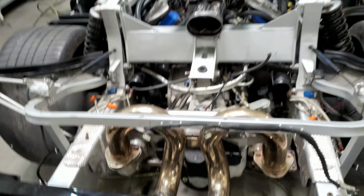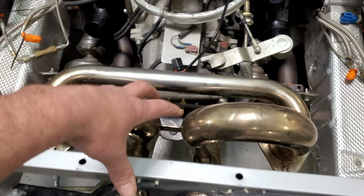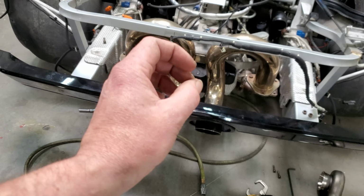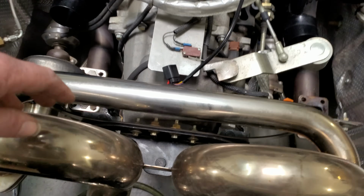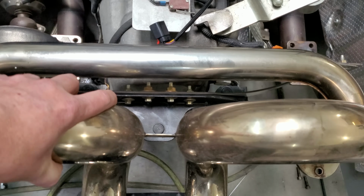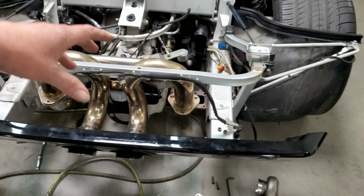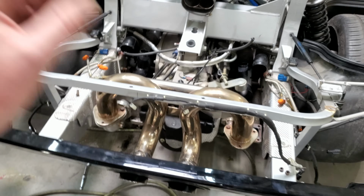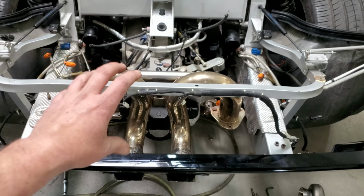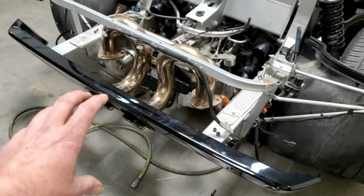While that may not have been in the plans, redoing the entire exhaust system offers the opportunity to update it. We'll get rid of this balance tube, we'll do a merge on these here, keep the exhaust tips lined up where they're supposed to be, and redesign a mounting system that allows the flex to happen in that system, but not in the exhaust system where it's going to be smacking the crap out of that bumper and stuff like that. So communicating that and talking to your customer or client and explaining that this is probably a better idea, because technically it takes less time and you're almost guaranteed to make it work better than fighting the original one.